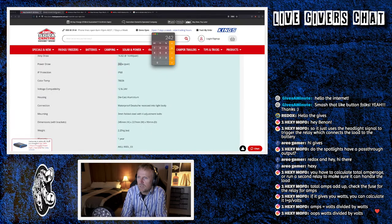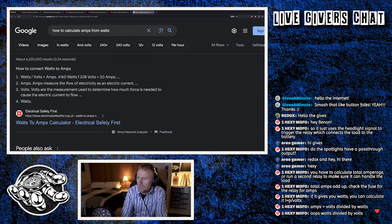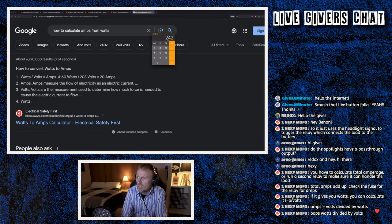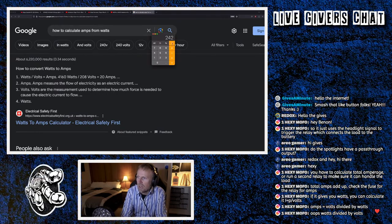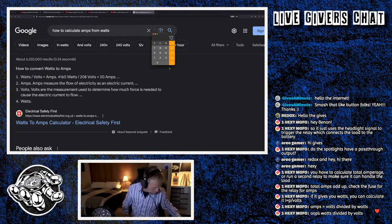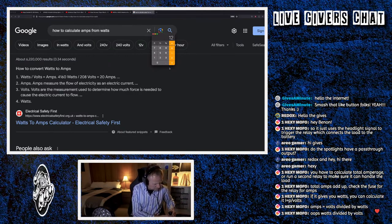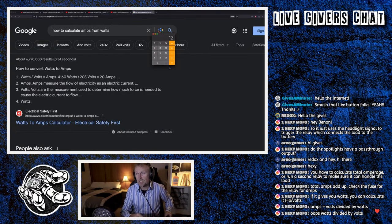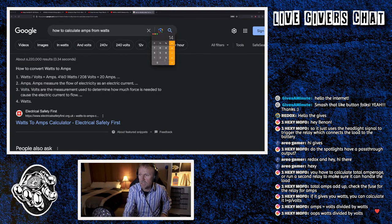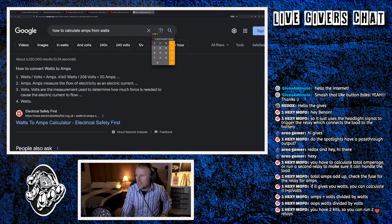242. What was this formula again? Watts divided by volts equals amps. So 242 watts divided by 12 volts, because that's the relay we're using. Actually, this says 14 on it, so we've got a little bit of extra to play with. We'll change 12 to 14. That's 17.